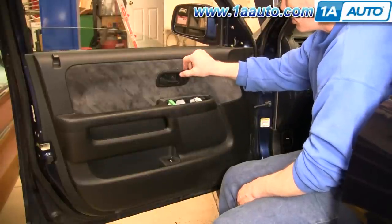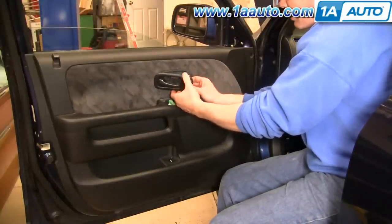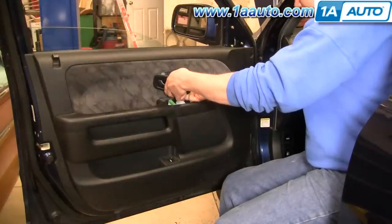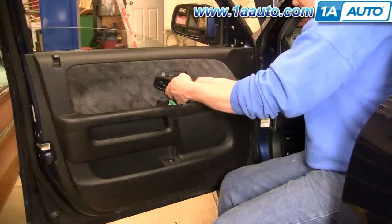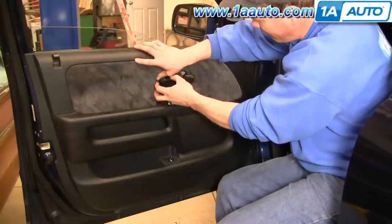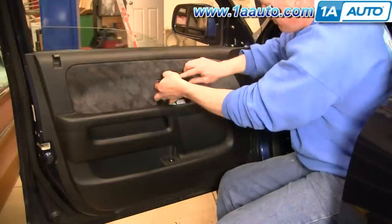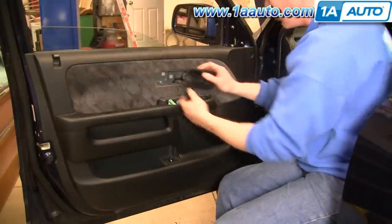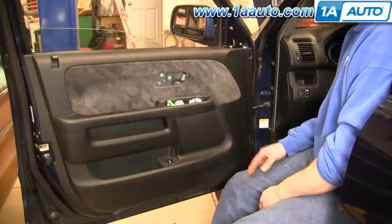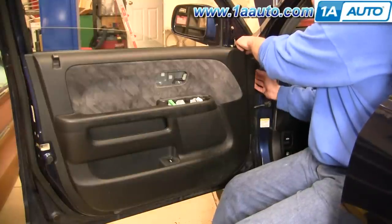You'll need to pull your door handle out here. There's a little button for the connection for your power lock — press that button and disconnect your power locks. Then there's a little clip back here; flip that clip off and pull this rod up. Your door panel and door handle come out. Once that's all set, you can start at the top corner, pull firmly and try to work your fingers down.